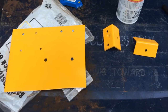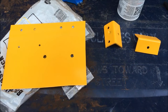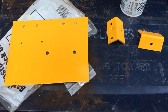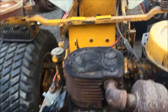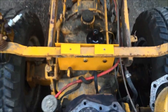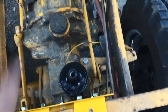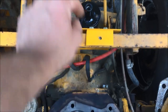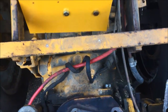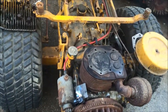I painted up all the metal pieces and I'm going to assemble them together, then we're going to drill the holes on the machine to hang this. I brought the panel over to the tractor and found where I want to mount it, making sure the coil is over enough so it's not in the way of the linkage. I drilled two little pilot holes with a quarter-inch bit, which will give me two places to drill the holes, and then we'll mount it and do some wiring.